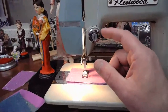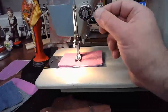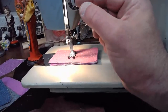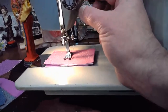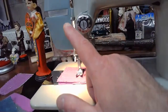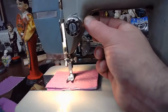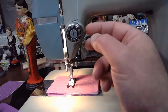The big problem with this upper tension that arrived in pieces to the workshop and was missing several parts is, when you're going to mount an upper tension like this in a machine like this, it's a two-stage process. First of all, you've got an inner core that the stem of the upper tension is going to get mounted into, but you've got to mount that base on the inside of the core of the machine first. And then you slide that stem in, and then you anchor it into place. There's a screw that secures it just on the inside of the faceplate. But the diameter, when they cast these machines, as far as getting that mounting base inside of the machine so you can mount the rest of the upper tension unit to it, all of those are different circumferences.